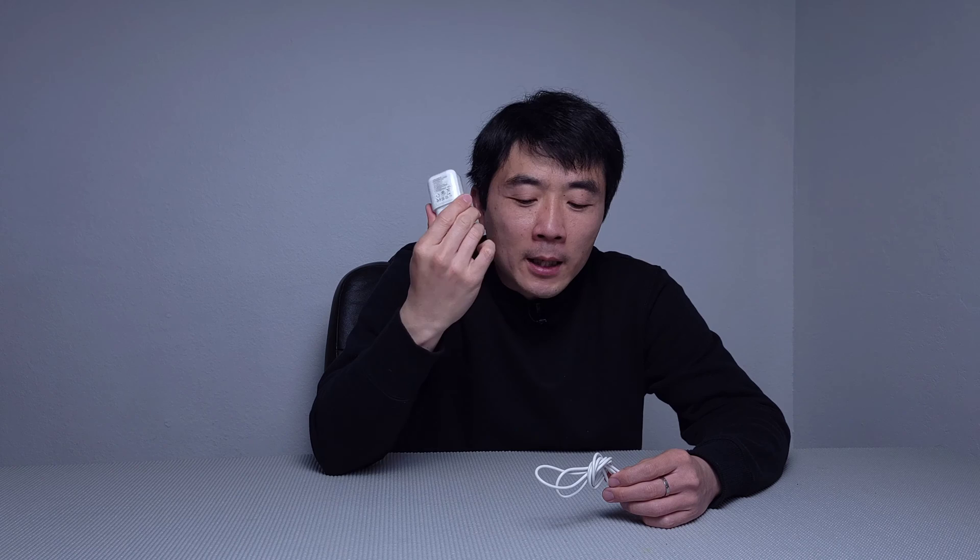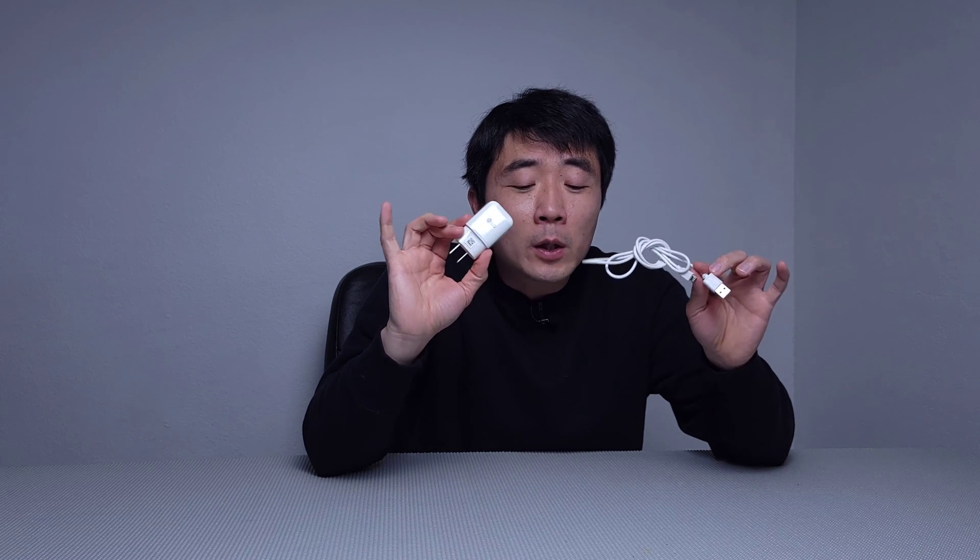Basically, the moral of the story is: if your TV's USB output is not strong enough, your Amazon Fire Stick will have a boot loop. The Fire Stick requires a minimum of two amps to power it properly. So make sure you get a plug that provides at least two amps, and also a micro USB cable that supports two amps and above — anything that came with your phone should work fine.